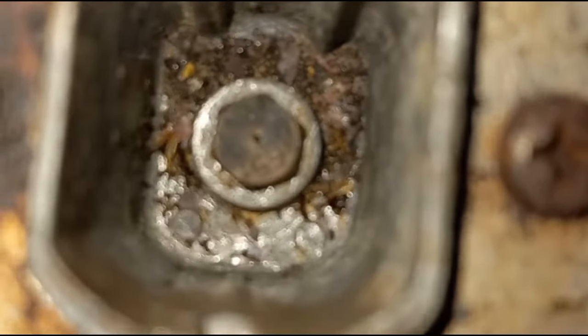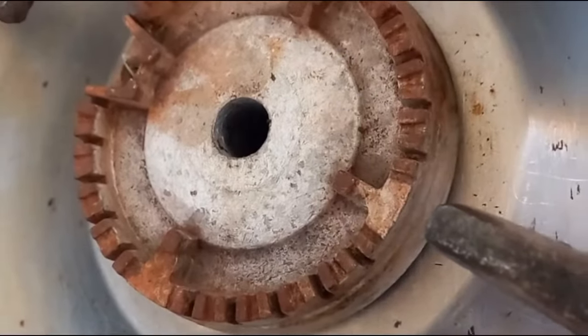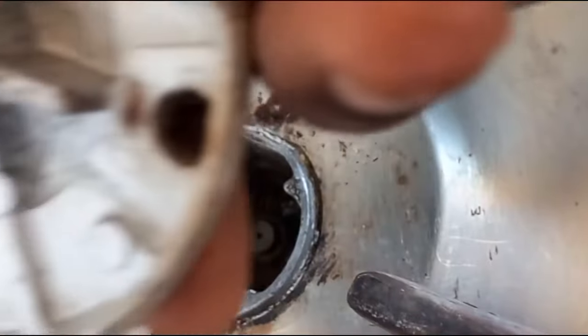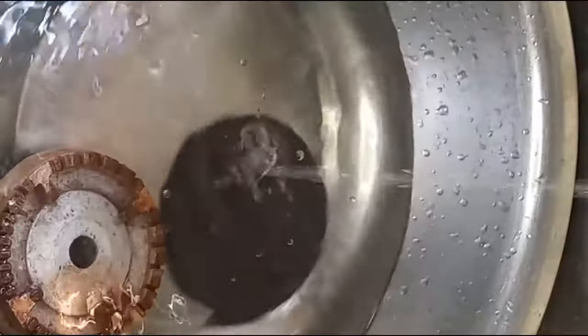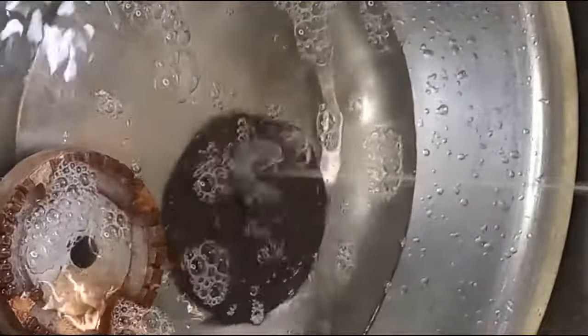This is the reason — you see this deep panel over there. As I zoom the camera, you can see there is some debris and dust in there. That's the reason why the flames come out yellow. Because of the debris and dust inside, sometimes you see scrapes of metal from the iron burner, dead insects, dust, and all of that.